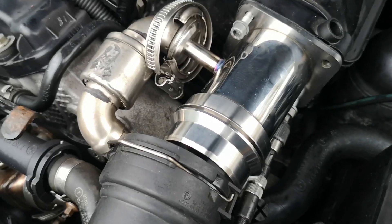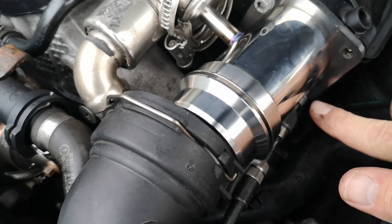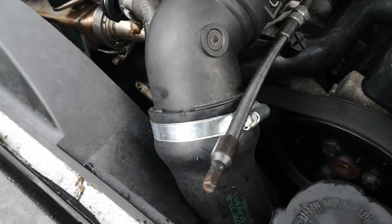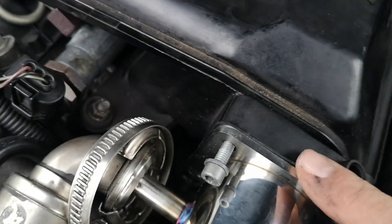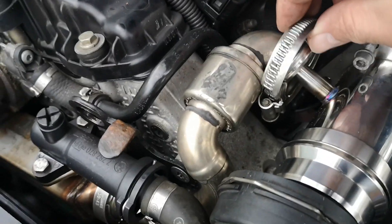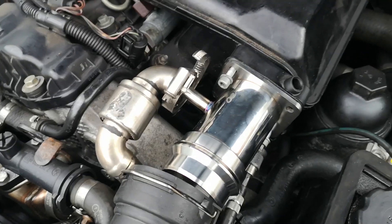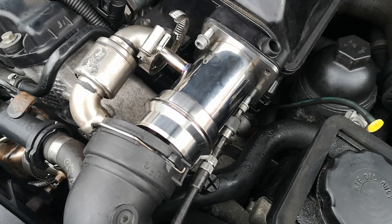When putting it back together, I recommend getting your top one in first, then go to the diagonal side and get that bottom one in — that's where your flex comes into play again. I'll probably get the gun on that to tighten it up, not too tight but tight enough. Don't forget your rubber gasket that goes in just behind the EGR valve, and your little clamp. Get everything loosely in position so it all lines up, then tighten everything up and job done.